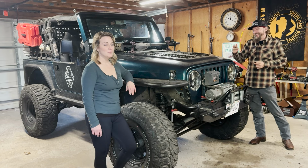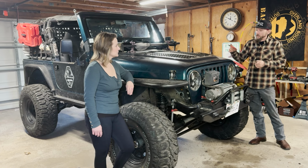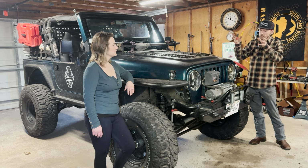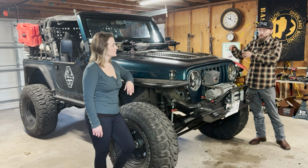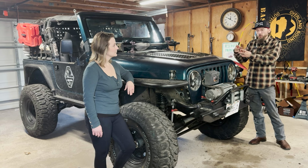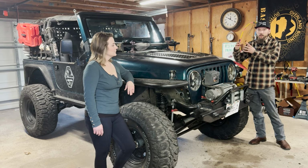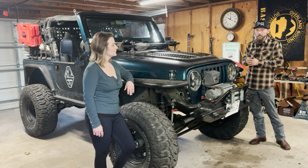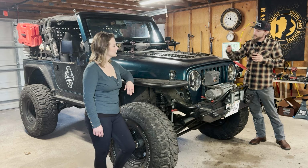Next, we have a new manifold. Yeah, exhaust. Exhaust on this. This is a 98 Jeep TJ. So in this model, all six cylinders come into one collector. On the later models, they separate into two different cats. But at that collection joint, there's a few welds, and it's just rigid and everything's shaking and vibrating on the trails. Those have cracked, and I've welded the cracks, and it just keeps cracking again. So that one, pull the intake off and get the exhaust on.